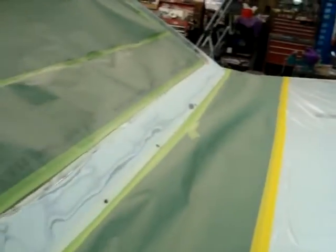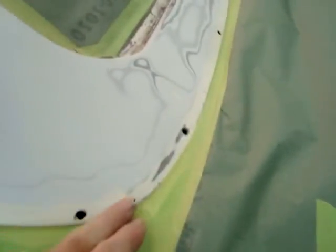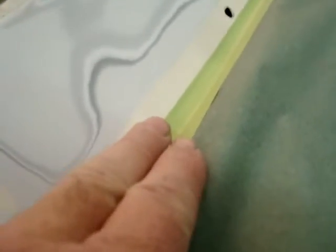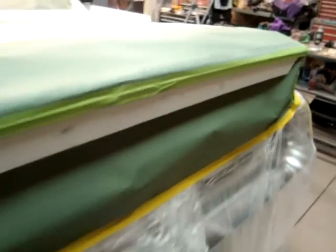You can see the seam sealer on this side also. This molding around the roofline had never been out before — it's like the factory paint underneath. You can see the difference in white; it's more of a yellow-white originally. This little panel on the trunk — I took the four letters off back here too and welded those holes shut, so I like to paint that panel.